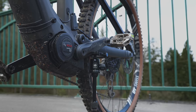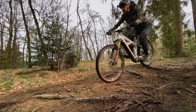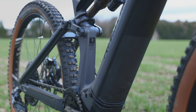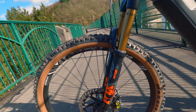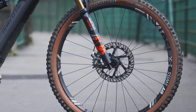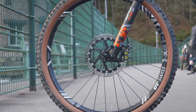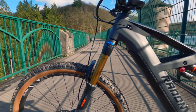It's a pretty good performer — it came out for 2020. This cover here is a very hard rubber; it dampens stones and debris hitting the down tube and protects the battery. It's secured on by an Allen bolt and clips in — this is just a retaining strap; it doesn't hold the battery in. Fox factory suspension on this model — the 36. DT Swiss rims, which are brilliant, really hardcore and can take a beating — perfect for e-bike. Tanwall Maxxis DHF and DHR tires. DPX2 shock with a piggyback. And Magura brakes — these are just monstrous, with a 220mm rotor on the front. One-finger braking; you've got to be careful because when properly bedded in, you can just lock up the front wheel.